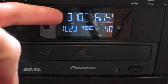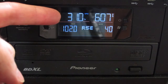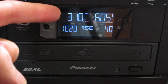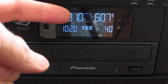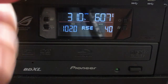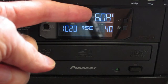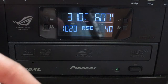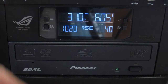Maybe during the course of my work this might bump up to 37 degrees. The only time I've actually stressed the computer so far is to make videos — when I render video with Adobe Premiere, this'll hit something like 52 degrees, so about 25–26 degrees above ambient. This here is the fan speed, and you can see that when I'm rendering a video the fan speed will jump up to about 750 RPMs.